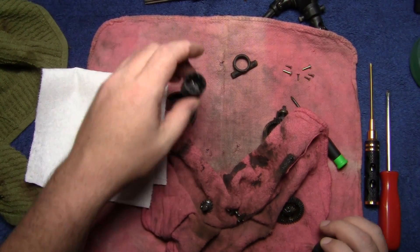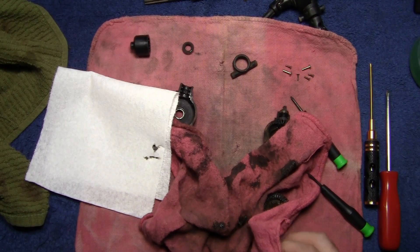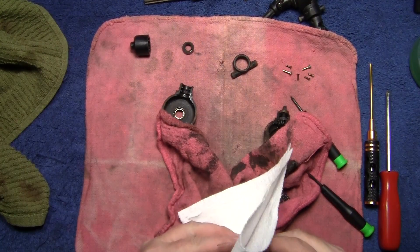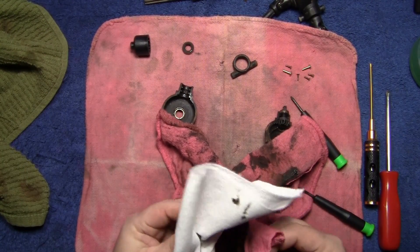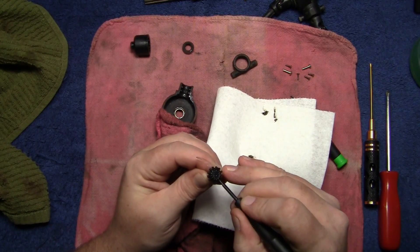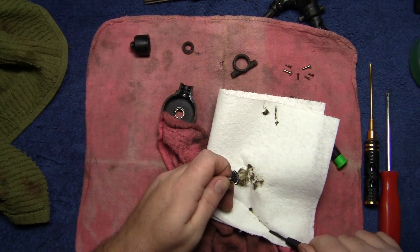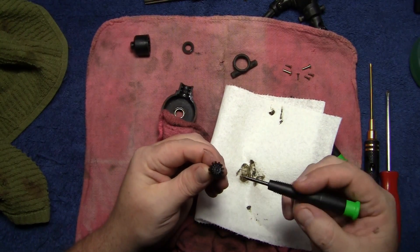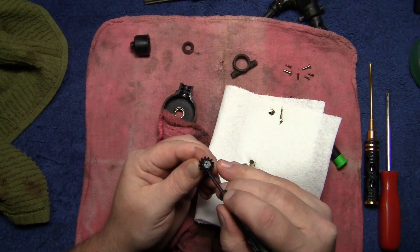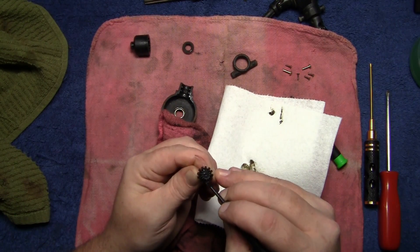Grab a new paper towel and use a flat blade to scrape up each of these walls. We're not going to get all the grease out but we can get most of it. Now grab this very sticky gear and try to get a lot of it off — just scraping down in between all the teeth to make sure there's no really hard grease in there. If you watched my last series on the T-Max you'll know exactly what I'm talking about.